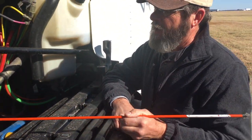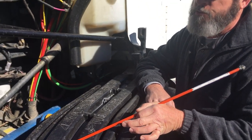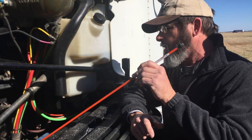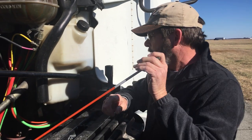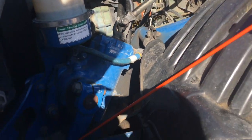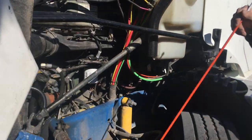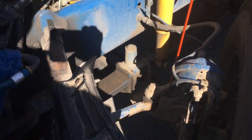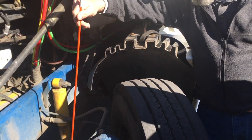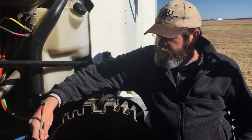My steering column is not cracked or broke, securely fastened at both ends. It comes into my steering gearbox, which is not cracked or broke, securely mounted to the frame of the truck — both nuts are all tight and secure. The frame of the truck right here is not cracked or broke, has not been illegally welded together, and there are no illegal holes drilled in it. I come down to my pitman arm — not cracked or broke — into my drag link, my steering knuckle right here. None of them are cracked or broke; they are all securely fastened with bolts, nuts, castle nut, and cotter keys. Tie rods are out here, not cracked or broke, securely fastened at both sides of the vehicle. They've got all their bolts and nuts tight and secure.